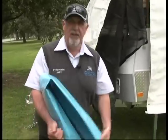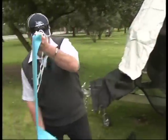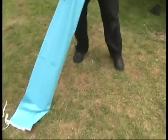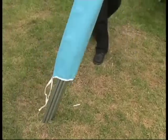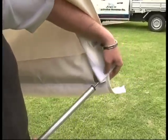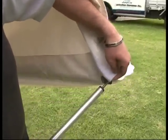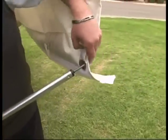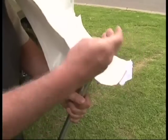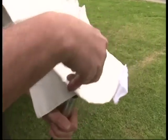The next thing to do is set up the awning. Take the poles out of the front boot and empty them out on the ground so you can see which ones fit where. Place the upright pole through the spreader pole and through the hole in the awning, then put the wing nut on the top until it's firm.